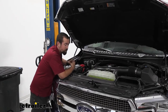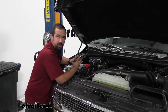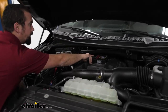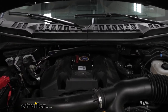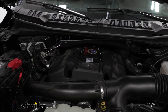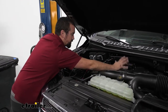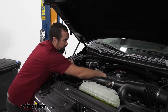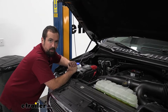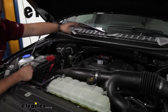For the install of this braking system, a big part of it is making sure all your components are in place, and the rest is just making the connections between all that. Finding a spot to mount your actual box is important — this is where your air is going to go in and out and also connect to your brake master cylinder. It's a decent-sized box, so I tried to find a nice flat spot that didn't get in the way of any maintenance you might have to do. It seems like an odd spot on top here, but it is flat and out of the way. When you need to work on it, it's as simple as taking the valve cover off. I left myself extra room with the wiring and air lines so you can move this out of the way with no problems.